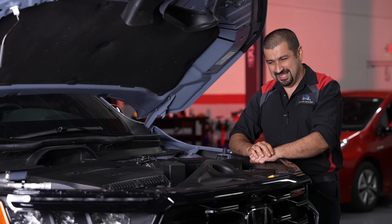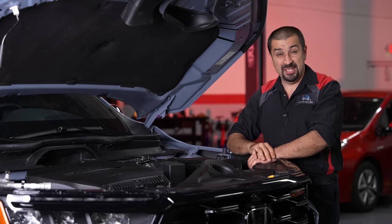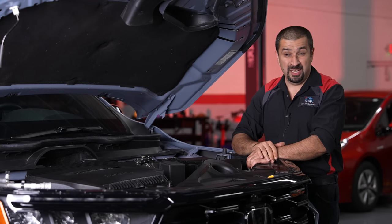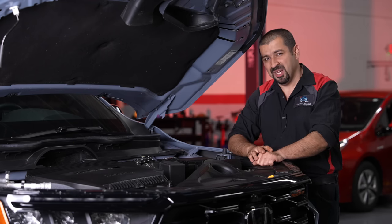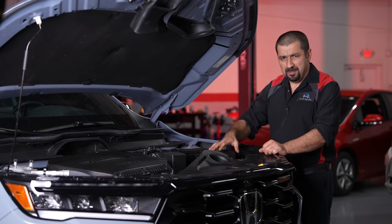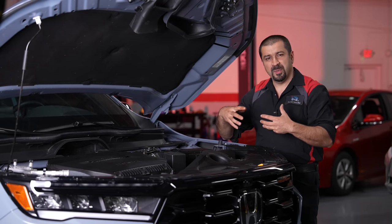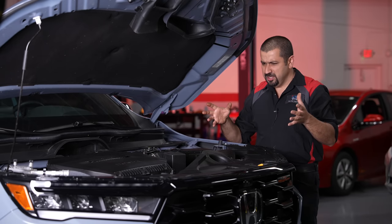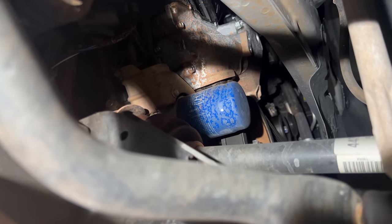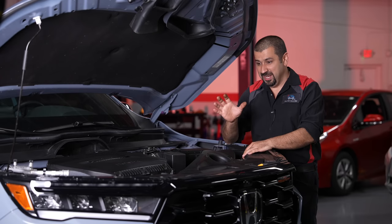Shutting down cylinders on engines is never really a good idea, but they do it for emissions, and that's why this engine has a very high emissions rating — pretty interesting to see on a naturally aspirated V6. The oil pump remains very similar, sitting right behind the timing belt and driven by the nose of the crank. The oil filter remains in exactly the same place, which it has been for a very long time.